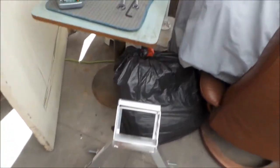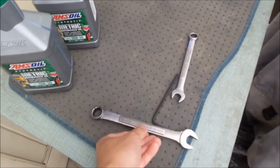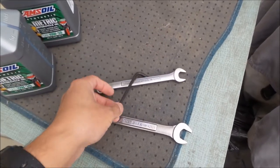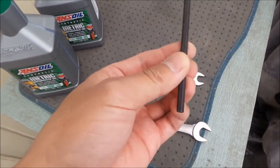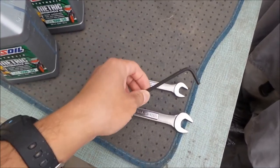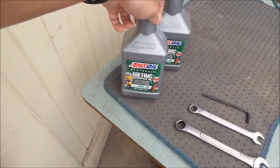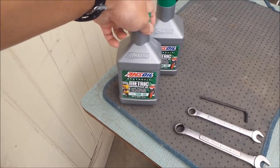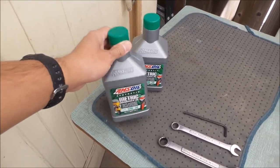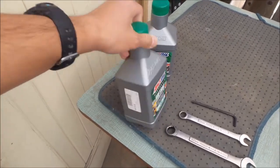I'm going to do it myself. It's a 17 for the drain plug on the bottom, and it's a 14 for the fill plug. This is an Allen wrench that comes with the bike — looks like a 5 mil — and I'm going to use that for the level check. I got two quarts of Amsoil Synthetic Metric Motorcycle Oil, 10W30. This is what was recommended from the Bramo site, and it's expensive — it's $14.